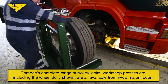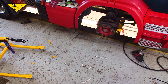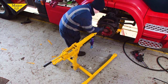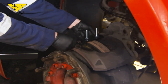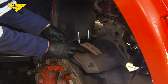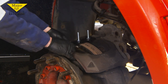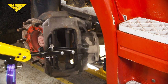The equipment is suitable for any vehicle or trailer, as the caliper crane can be adjusted to suit any position of caliper, even under slung. Firstly, removing the caliper: attach the caliper adapter to the caliper. While we're here, we're removing the caliper from the top of the hub, but this equipment can remove calipers from multiple positions.